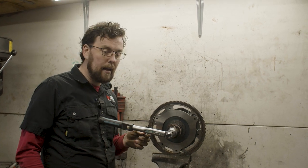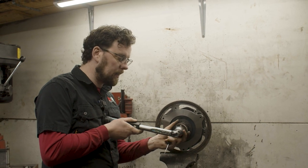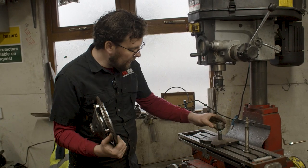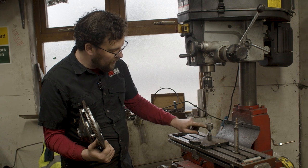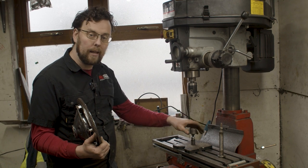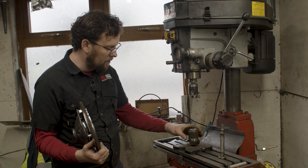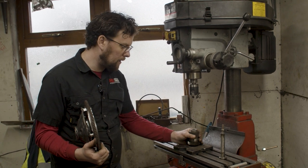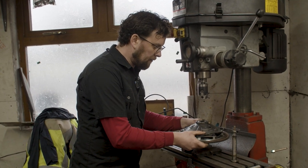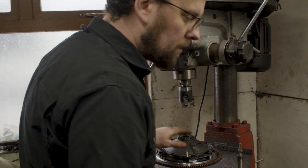We're going to do that by doing some machining. I also want to show you how much pressure it takes to release this diaphragm, so we'll go over to the milling machine. What I have here is an old nose of a crankshaft that I cut off and welded onto a flat plate that allows me to test things in the milling machine. I can also use this to set up a flywheel — I can put a primary gear on it and it'll allow me to essentially set up a flywheel. I can sit the flywheel on this as if it was sitting on the crankshaft and use the spindle of the milling machine to test the release pressure.